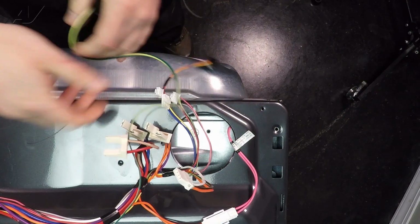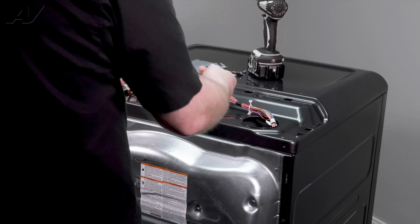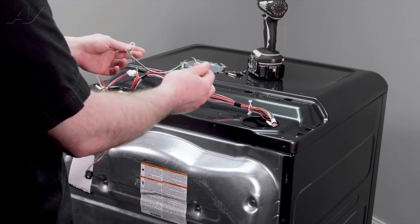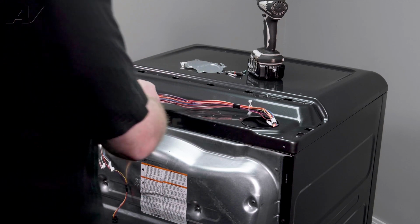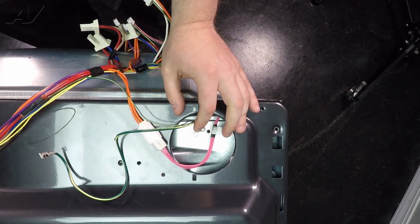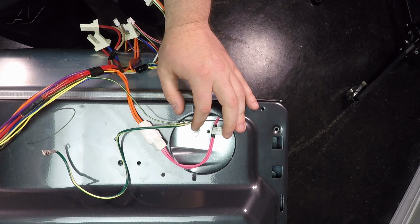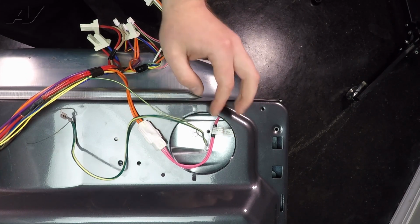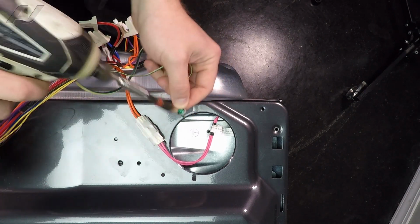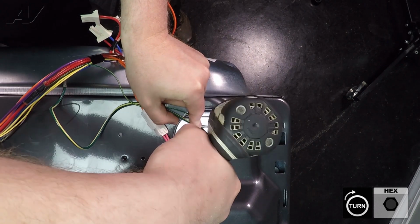Now, if you remember correctly, we had a ground strap that was screwed in. Now you have one main ground strap here. One is longer than the other. There's a square end and there's a circular end. The circular end is the one that gets reinstalled inside the chassis. So what we'll do, just pop that screw in it, hold on to the bit, bring in, drill it down.